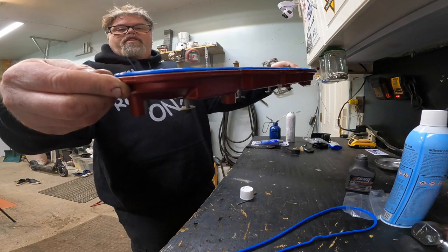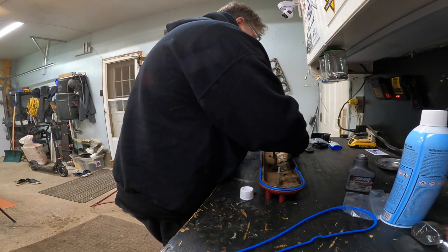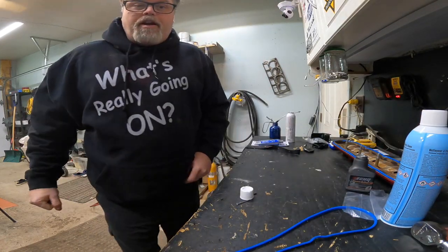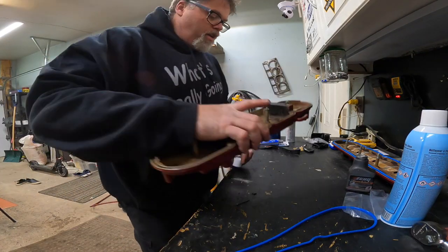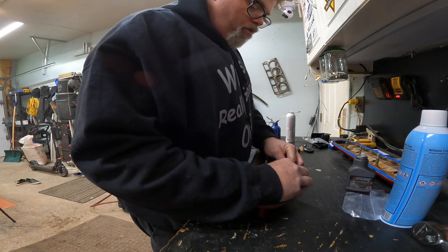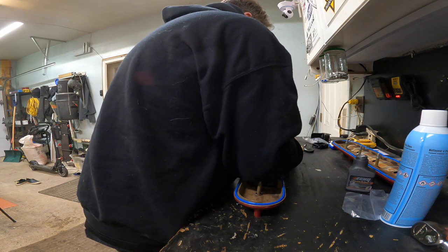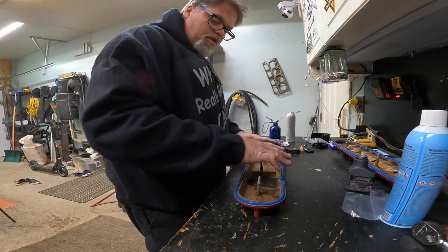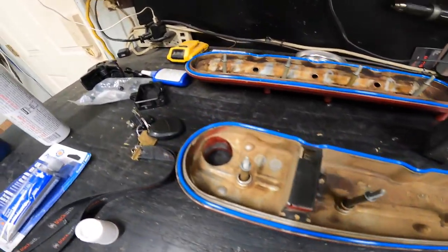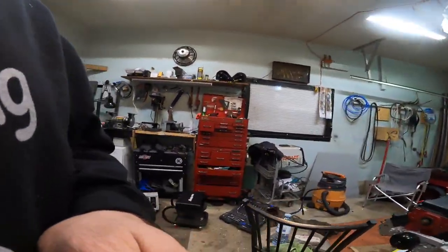Look at the seal on that — nice and high, it's classy. It's not staying in too good though, it's got a little bit too much stretch to it. Stay in your groove. We better just leave that like that because we're going to have to check it again. We'll get them in there so it'll kind of stretch, and by the time we're done bolting the oil pan on we'll be good to go. Put this in just like this — these are nice little gaskets here. Good job Moroso. Nothing like a good snug job. They're in.